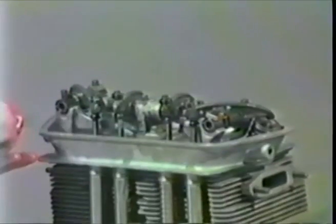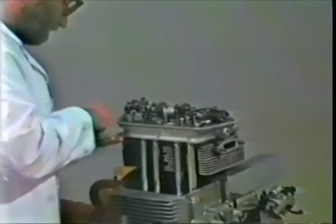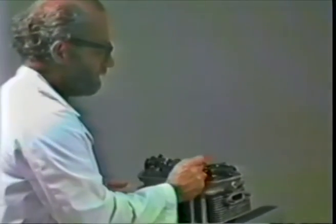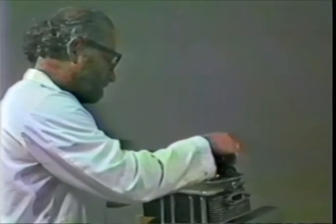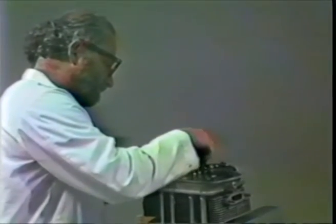And then the same type of washer, regular washer, spring washer, that's used on the third piece, a smaller OD style 8mm washer, is used on top of the saddle washers. And then very special thin 8mm nuts with standard thread. These nuts are different than the valve adjustment nuts. And though the valve adjustment nuts look the same and are very close, they are not the same. So don't use the valve adjustment nuts for the rocker tie downs.